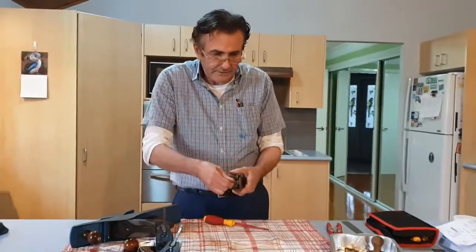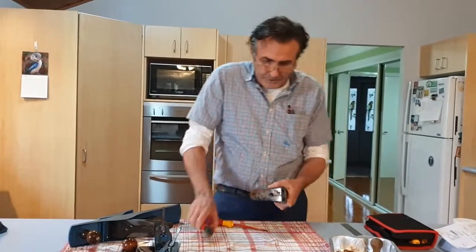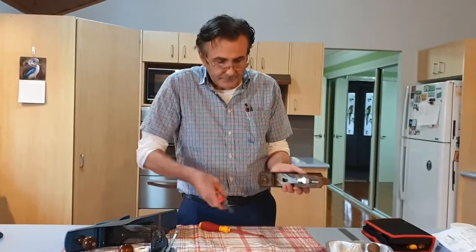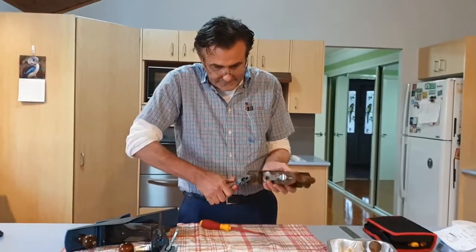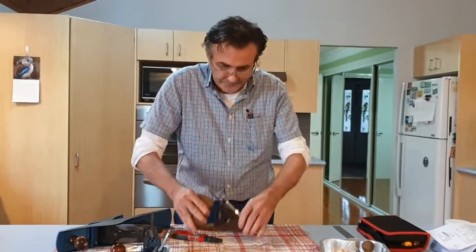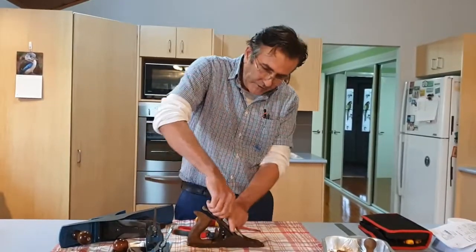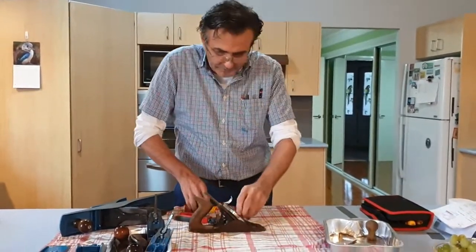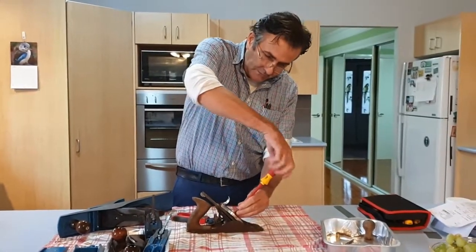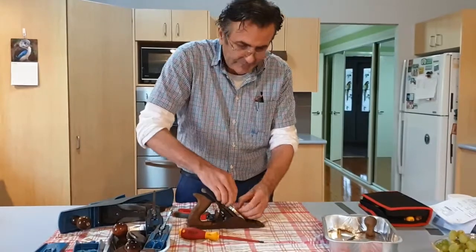This little shaft here is still in there. Grab a pair of pliers or stilsons, grab it on the unthreaded section, nice and tight, and off it comes. Wind it off. Just loosen your cam here at the front — that'll make the front nut easier to remove. Unless it's a bit rusty like this one, it should come off quite easily.